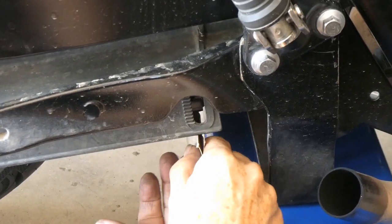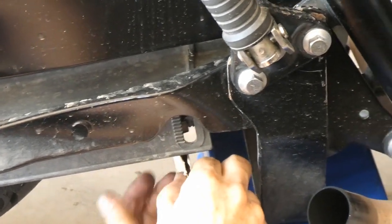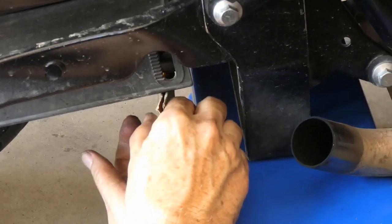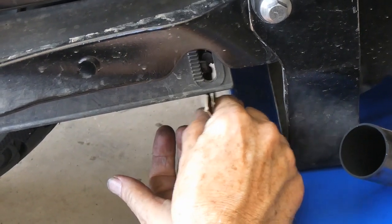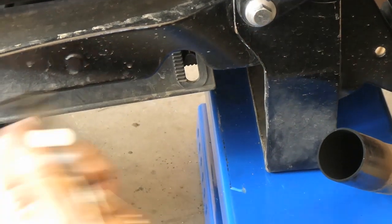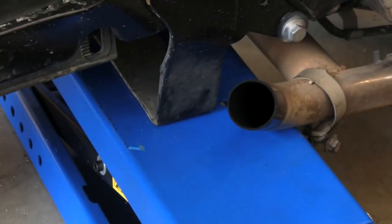There is a different tension on different parts of the belt — surprising, but they do mention that in the manual. You'll already have to adjust the gauge to get it to line up again. Measure the gap between where it moved down to and the bottom of the O-ring, then move around to a different spot and recheck.